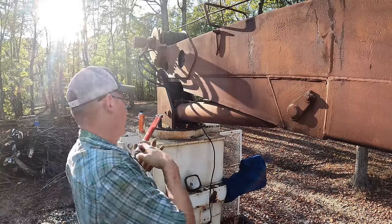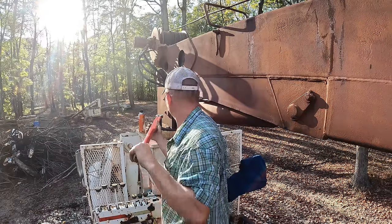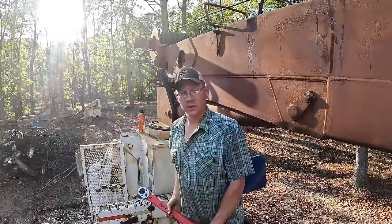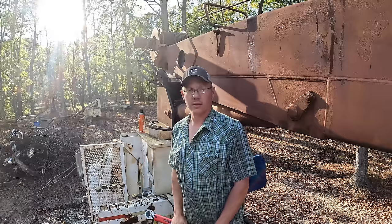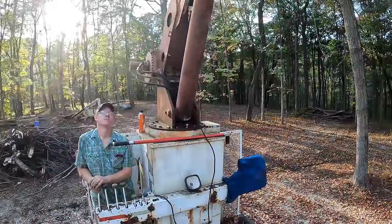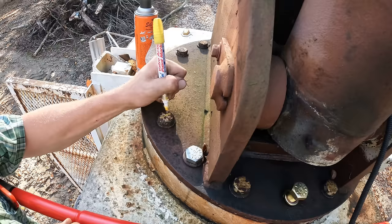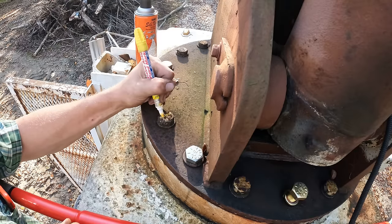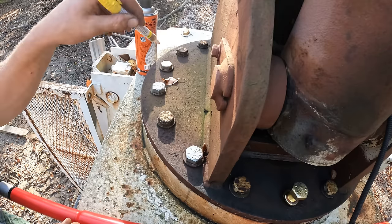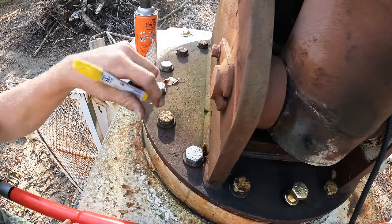Woo, that's some pressure. There we go. I'm gonna try to stand the boom up, that way I can get to all the bolts a lot easier and we can actually rotate the crane around to get easier access to them. I'm also gonna mark each of these bolts as I torque them. I'll give them one line for the first torque sequence, and we're gonna do them all twice. So after the last one's torqued, we're gonna go back around and recheck them. And then at that time, I'll mark them on the side so that I'll be able to see if they ever loosen up.